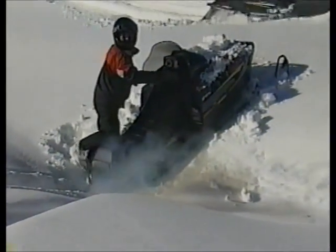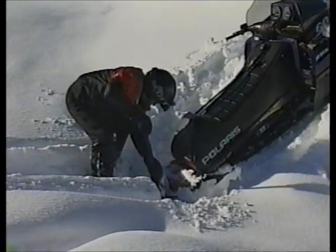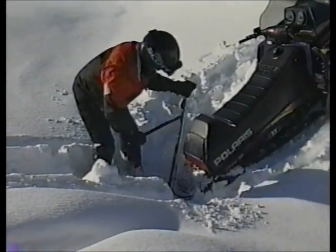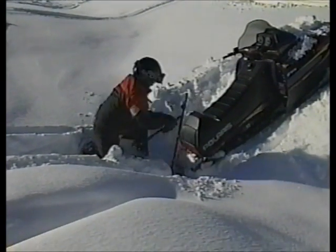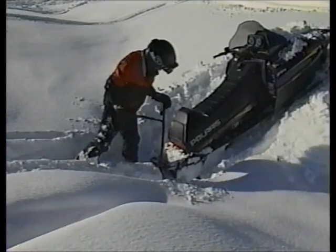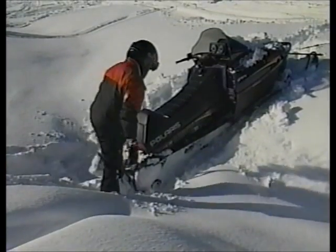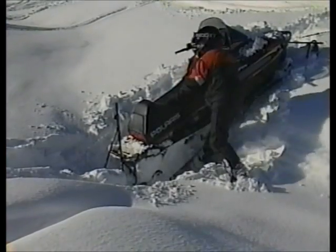Into the gully. Oops. Maybe it'll come out. Maybe not. Bumper below your feet. Track locked into snow that grips like cement — this can be real trouble. Shovel first, then set up short close to the sled. By pulling back on the jack head to break the sled loose, then lifting with the jack handle, one man can do the work of three without risking a back injury. After the track is out of the hole, you can kick snow under the sled to set it back down. Reset Snowbuddy at full height to lift the sled high enough to move it away from the hole.